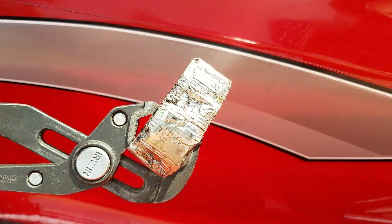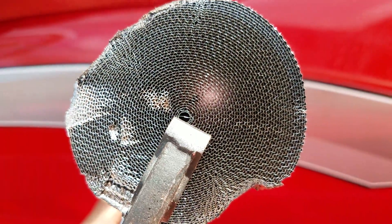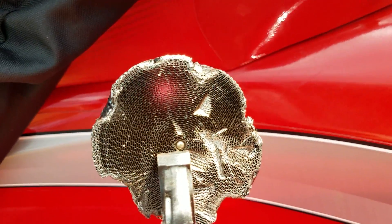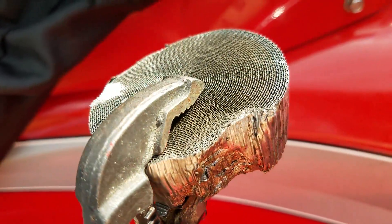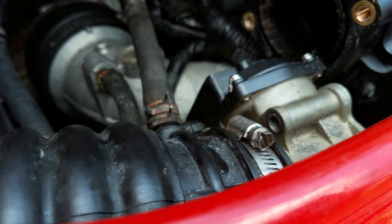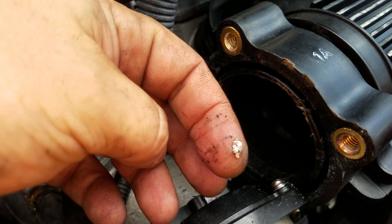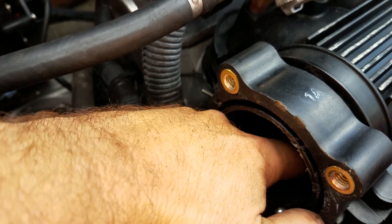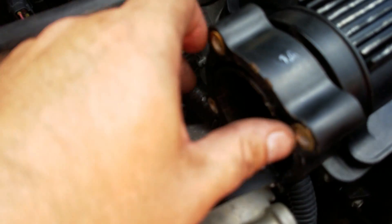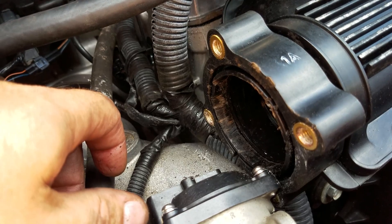Here it is basically out. As you can see it's very fine, so you're definitely going to gain a few horsepower. I did this on my other skis and definitely felt the difference on my Yamahas. Make sure you have nothing left in your intake, clean it out, wipe it, and then put your throttle body back on like it came off with all four bolts. That's it, thanks for watching.